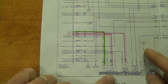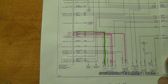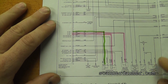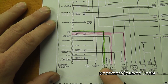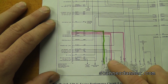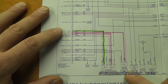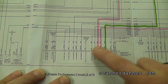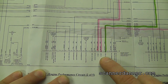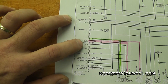What we're trying to determine is what sensors are using each reference — which ones are using REF 1, which ones are using REF 2. We see the APP sensor — that's accelerator pedal position — is actually using one of each, so there are two different sensors in there using two different reference circuits. Our fuel tank pressure sensor is on reference 1. Coming over further, we see another portion of the engine computer with dotted lines, so these aren't six different reference circuits. On page 1 there are two reference 1s and one reference 2, and those reference 1s are tied together internally.